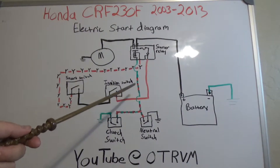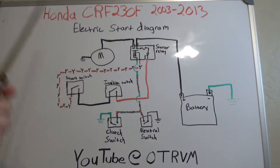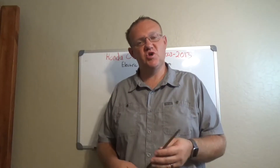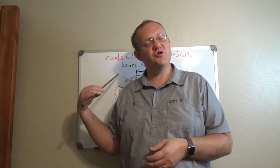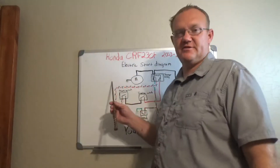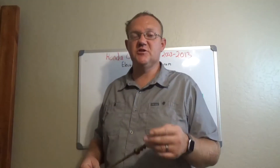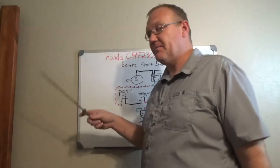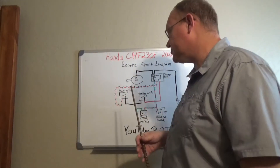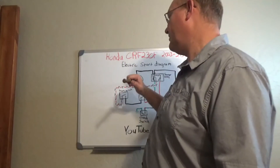This is just a quick assessment to help you out. Thanks for watching — it was a quick video on the electrical start circuit for that Honda. Someone asked for it because they're having the same issue, and I actually run into this kind of stuff all the time. Stick to the KISS principle — keep it simple, stupid — because it could be something as simple as a fuse or a loose connection. You don't want to go tearing everything apart and pulling the starter out when it could be something else. Hope that makes sense, hope you all have a good day!